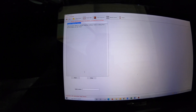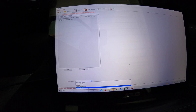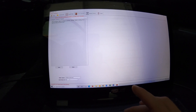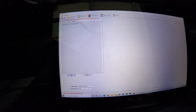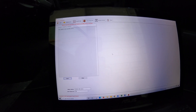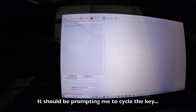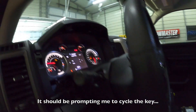I'm going to do the same steps as the app — going to active diagnostics, run down to program customer features, then go down to lifetime idle hours and enter 299. We're going to hit start and see what happens. The option is currently set to 43.